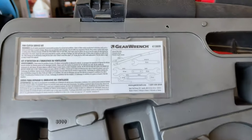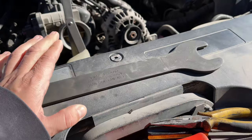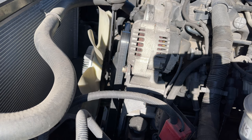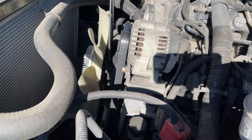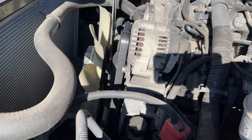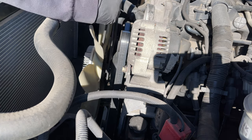The kit I used is a Gear Wrench — I'll try to find a link and put it in the description. For the big nut I use a 36-millimeter socket, which comes in the kit. To use the tool, grab those little clips and put them in the holes on the pulley — it has four holes so you can put one on either side. Once it's inside the pulley, turning it turns the entire pulley, which holds it steady while you work the nut.